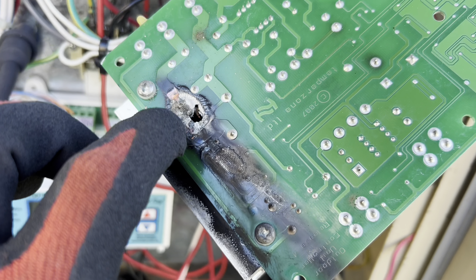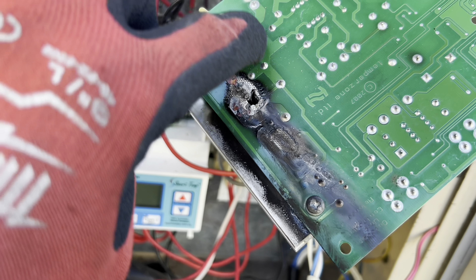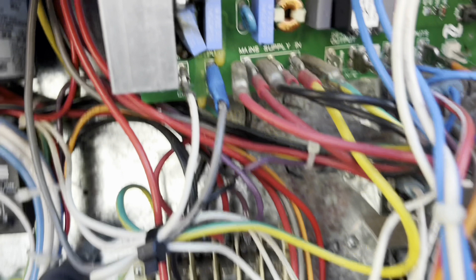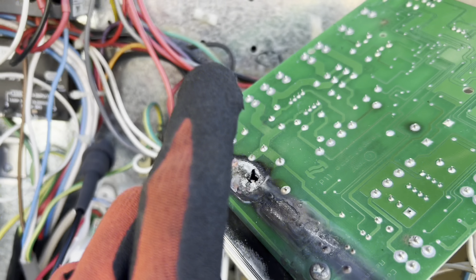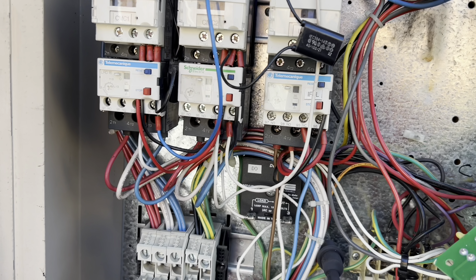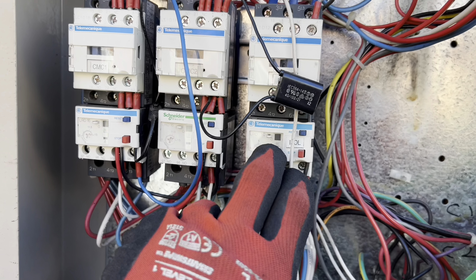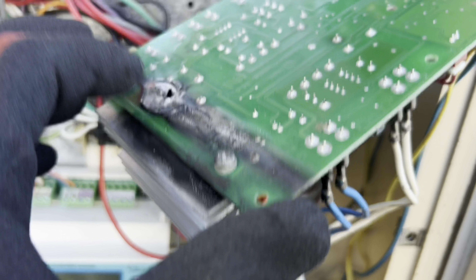Just following the tracks — this is our input supply side here. The burn does appear to be on the output supply side. You can see the main output supply, but I am getting no reading across anything — no compressor readings, no indoor fan readings. So yeah, we'll keep looking into it. I'll test some of the points. These are just to earth. I think this is that coil. Even if I do get a reading here, we know the board's a problem.